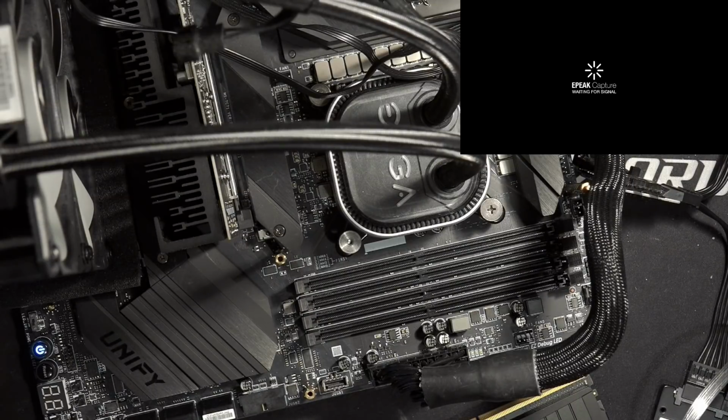So you wouldn't get them on 16 gig DIMMs because the chips were in high demand for 32 gig DIMMs and server DIMMs. And there was no reason to make 16 gig consumer memory sticks with expensive 16 gigabit memory chips in single rank. But now 16 gigabit memory chips are very common. And so having memory chips on just one side of the memory stick is cheaper than having memory chips on both sides of the memory stick. It simplifies the manufacturing process.